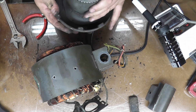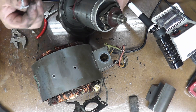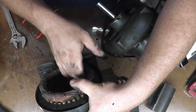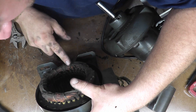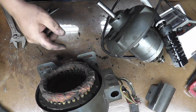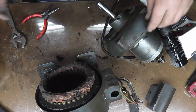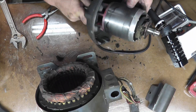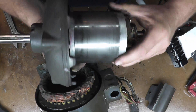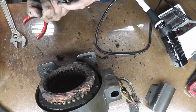As far as the windings themselves go, I don't see any indication of burning or anything. What's black is just dirt — everything looks okay, just needs to be cleaned up. The inside has no real scarring; there's one little mark but I think that's just from the factory because you can actually still see writing on it, so that surface never touched.